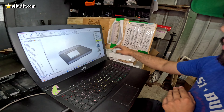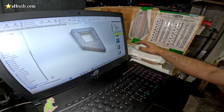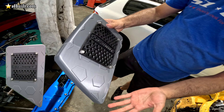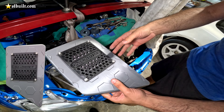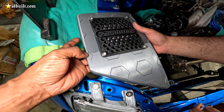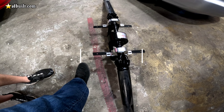Over here it doesn't actually line up with where it would bolt up to the head because this is an LSVtec setup and this kit was made for a GSR. So basically we're making an adapter plate that is going to bolt down here lower, and we're actually going to thread into this plate here and also bolt it from here and secure it. I'm making some spacers — I already have the sizing from the distance of this to the actual face here so that this will be completely flush when we bolt it down and sandwich it all together. Then we're going to tap these so they're threaded for the bolts to go into the actual plate, and then bolt the back side from the 14s as well with this adapter plate.